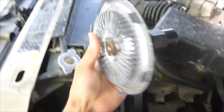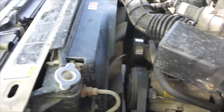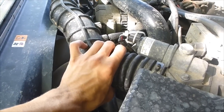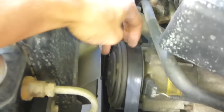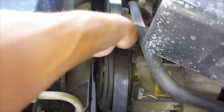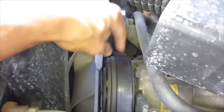Here's the nice new part. To get this part in, we'll have to take off the air intake hose right here, take off the fan shroud, and those two things should give us really good access to the fan. We'll also have to take off the belt — I'm replacing my belt since the car has almost a hundred thousand miles on the original belt. Plus with this fan being stuck, the belt is definitely slipping at higher RPMs, causing a lot of wear.